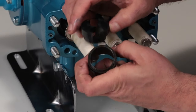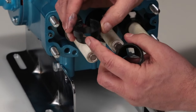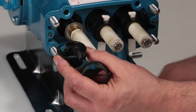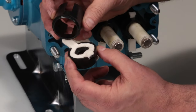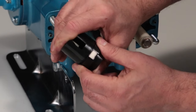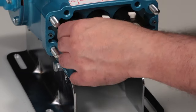When reassembling the retainer, you will notice that the bottom piece of the retainer has two tabs. These must align with the opening of the top piece on the retainer. Install the wick into the front retainer with the long tab facing down. Use the tabs on the top and bottom of the rear retainer to align and press together. Slide the seal retainer over the ceramic plunger with the long tab facing down.